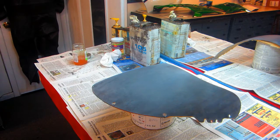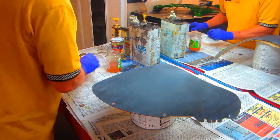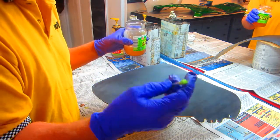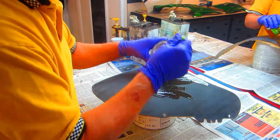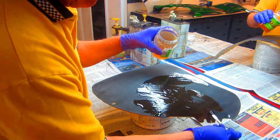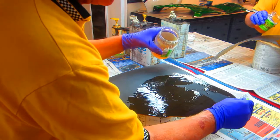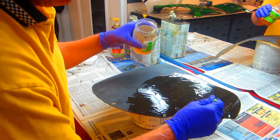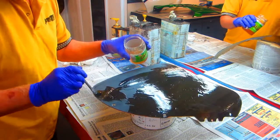I'm going to try to do this part without a camera cut, because that's the part I think most people interested in making a part like this would want to see — and keep in mind it doesn't have to be a windshield. It could be another example like the heel guards on most sport bikes. This is a flux brush; I put a little bit of tape on the end to keep it from ripping the glove. You can buy that carbon off the internet — you can actually buy what they call reject, which has one bad thread in it. If you're not going to see it, just put the good layer on top and put the one with the bad thread underneath.